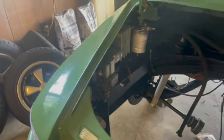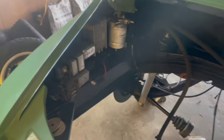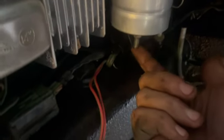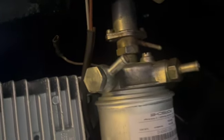All right, so we're going to start running fuel lines. I've been told the fuel line diagram, the one that actually came from Porsche's factory workshop manuals, is wrong and you're not supposed to follow it. So on this fuel console, you have two supply lines coming in from the tank. One is actually return, I correct myself. After it goes to the fuel console, this is directly the filtered main supply that goes to the pump. The pump has 2 barbs on it. Now we still have 3 barbs up top here. Plus we've got the cold start injector, the spray and pray, which is 5 millimeter. All this other stuff is 7 millimeter.